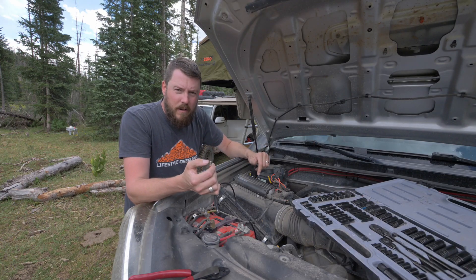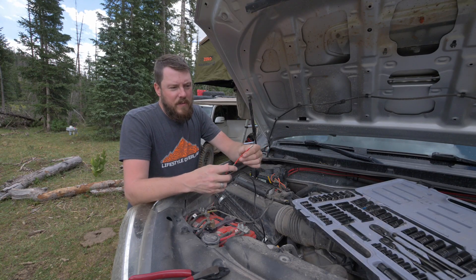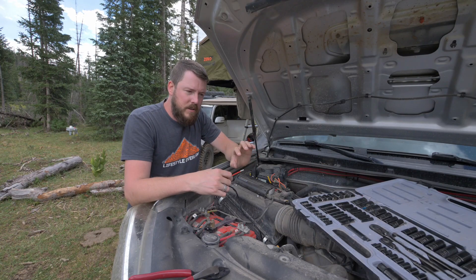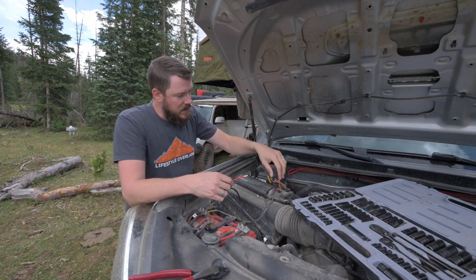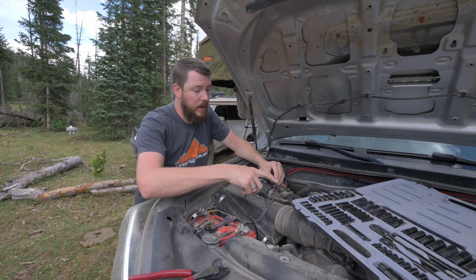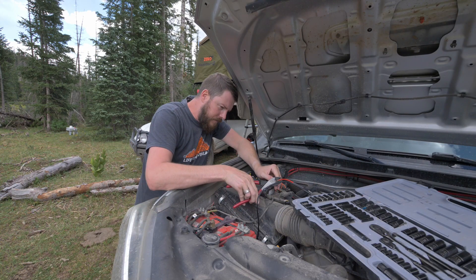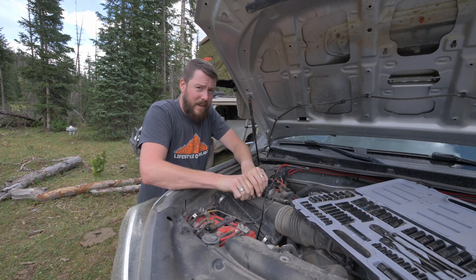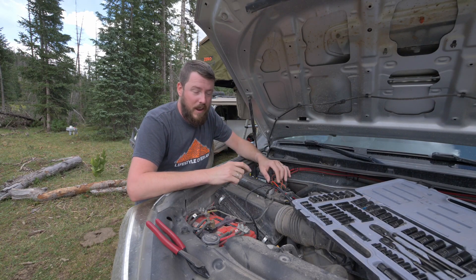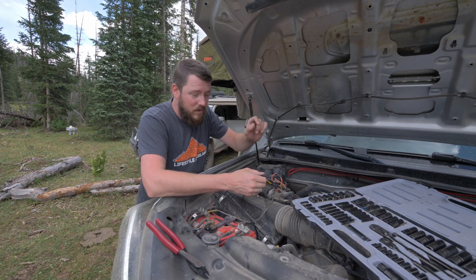I prefer using these bare splice terminals — they come in a kit off Amazon and also come with heat shrink. I prefer doing that over the all-in-one heat shrink type, because sometimes when you go to shrink it, if you've damaged the coating, it can open itself up. Eventually I'll be changing all this out too, to make it better insulated. Now I know a lot of you are going to say, aren't you going to solder that connection? That's what you're supposed to do for automotive. Well, I've been crimping terminals most of my life — my background being an electrician. A properly crimped terminal is just as solid as a soldered connection. Feel free to comment down below, but I have never had a single termination fail.